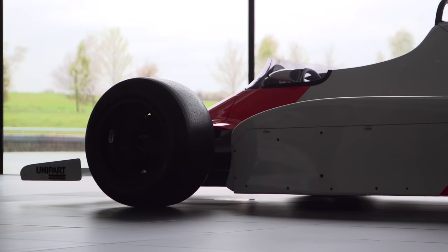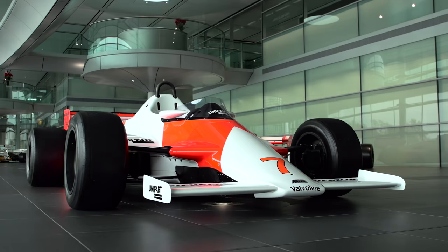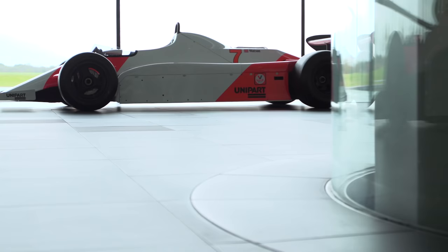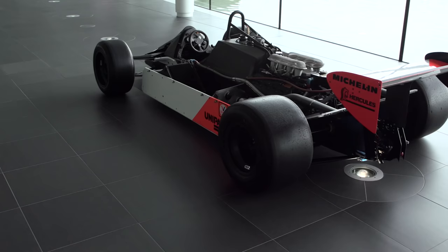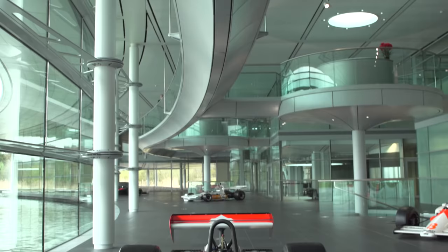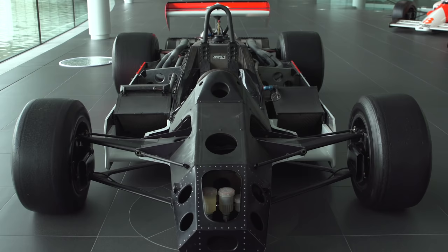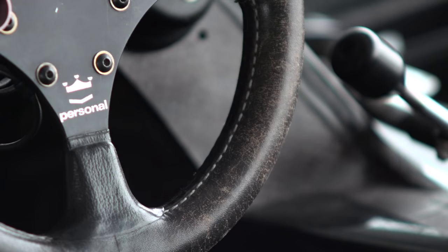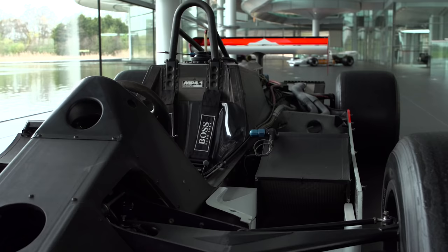I got talking to some people at British Aerospace. That's how I started to understand and learn more about carbon composites. At the time we had ground effect working on the cars, with shaped underbodies and skirts. To optimise that you needed as wide a clean underbody as you could get, which meant making the monocoque — mostly made from sheet aluminium with steel reinforcements — narrower, and I was going to lose torsional stiffness. So I thought: how do I get the torsional stiffness but still make the monocoque narrow? That's when carbon really came to the fore, because weight, strength, and stiffness are just superior to aluminium and steel.